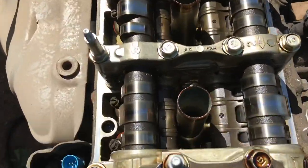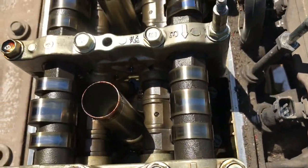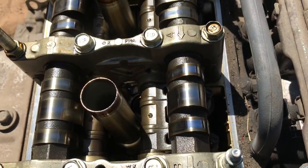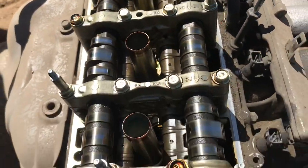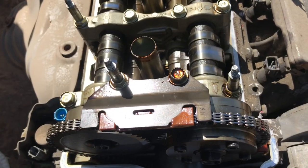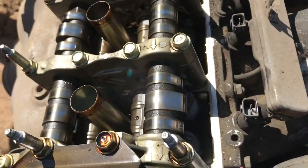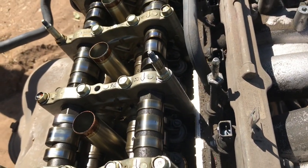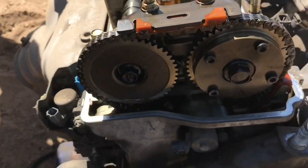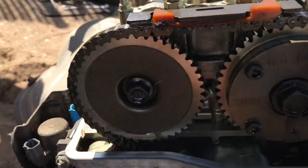You can look — the cams are still in good condition. Really, there's nothing wrong. The heads are brown, so they kept up with good oil changes. That's a telltale sign to let you know how the motor was treated. If it was treated poorly, it'd usually be black — that means they didn't change the oil at all. So I came to that conclusion.